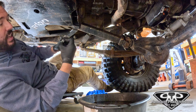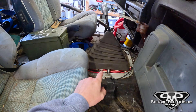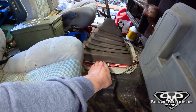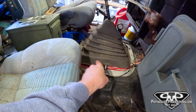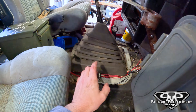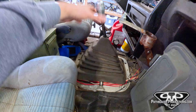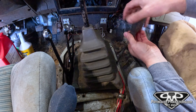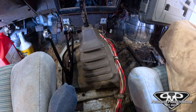It's been more than a decade since I looked into this thing — that's not so bad really. Now I obviously don't have any carpet in this thing, but most of you probably will. The way to get into this shift boot is the carpet tucks up underneath here, so you just pull the carpet back and then undo — with a 10mm or a Phillips head — the bolts that hold this ring on. Caution: this ring is really, really sharp. Ask me how I know — I've cut myself on it multiple times. Take that ring off, then take the shift knob off, and then you can take this whole boot assembly out. There are seven bolts holding this ring down.